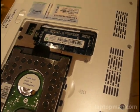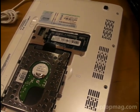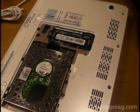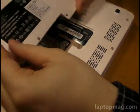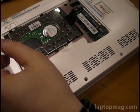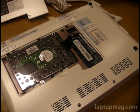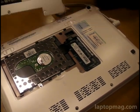If we pop this out and put in a one gigabyte DIMM, are we going to get one and a half? If we put in a two gigabyte, is it going to recognize it and see two and a half? We're going to have to find that out later. But it definitely looks like there are some upgrade possibilities here, nice and easy. What we don't have easy access to are the PCIe slots, where we might want to try swapping out the wireless or putting in a mobile broadband card or something.